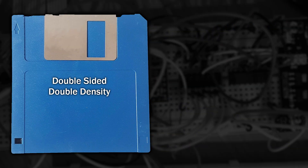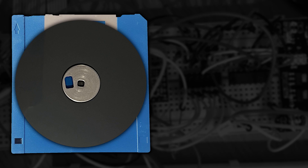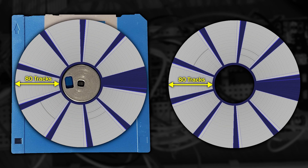Well, first we need to understand a little bit about floppy disk geometry, so we'll start with a PC floppy disk. These double density disks, when formatted, allow you to store up to 720 kilobytes of data, ignoring what the actual file system takes up. A floppy disk is broken down into a series of rings or tracks — and there's a lot more than I've drawn there. Depending on terminology they can sometimes be called cylinders, but for simplicity we'll stick with the word tracks. A normal disk is formatted with 80 tracks on each side, 0 to 79.